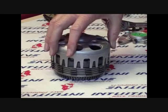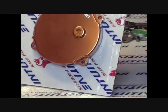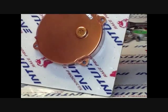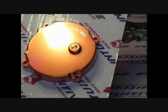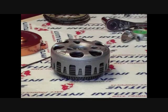Last but certainly not least, you may want to consider our aftermarket clutch cover with the highest fluid capacity of any clutch cover in the KTM 50cc motorcycle market. The stock KTM cover states a fluid capacity of 198 milliliters, while the IRP cover will give you an extra 127 milliliters of heat-fighting fluid capacity. That's a full 325 milliliters to help keep your clutch cool.